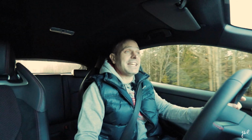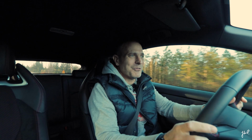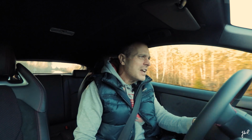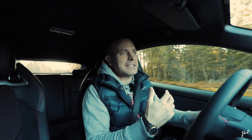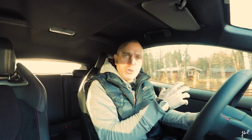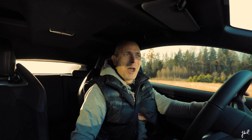Then, just adding to new great B-roads, and I'm going to talk about turning into corners, as I'm doing now on my favorite roads. Approaching a corner, heavy braking, and then turn in. And remember, when you change the wheels, as I've done to the HRE performance wheels, I'm increasing the offset, especially in the front axle, which will make this Toyota GR Yaris circuit pack turn into corners much more rapidly. Talking about instant turning into corners. Brilliant.